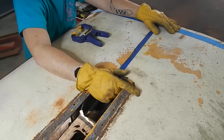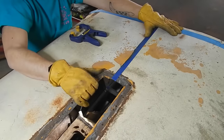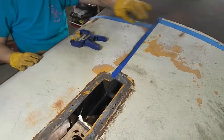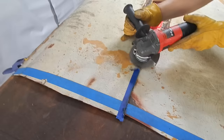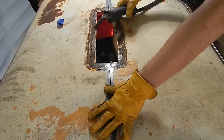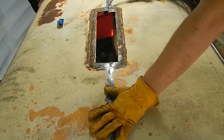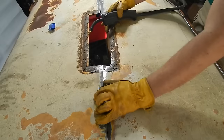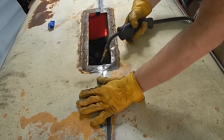Then whatever bulge is out over there will disappear because I'm going to cut the sections out to make room for everything else. I almost think I need to cut another chunk out — I'll grind it. So for now we're gonna put this right here. These are only gonna hold them in place — no shaky shaky welds. I don't care if they're good, bad, or ugly, just gotta make sure they don't blow through and hold this section together.